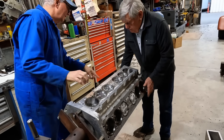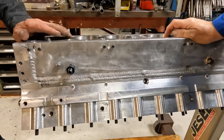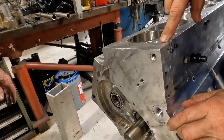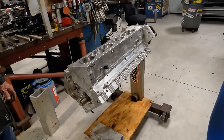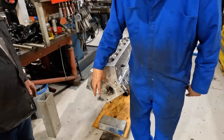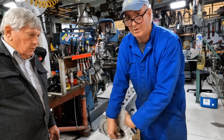We've got to run the oil down to the bottom — we had a problem with that. We need to get oil from here down externally. We tried to drill a hole in the block but it hit the seam and we ended up with water in the oil. We'll weld all that back up and add a fitting from here to the bearing. The theory is that all the pressure on the crank is downward and you can't pump oil when the bearing is shoved all the way down — you have to pump it from the top where there's more of an opening so it gets wiped around.